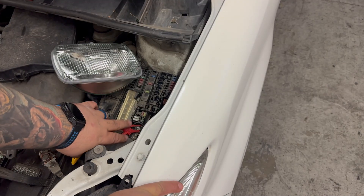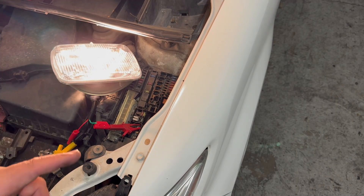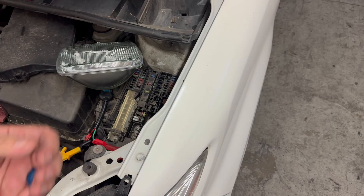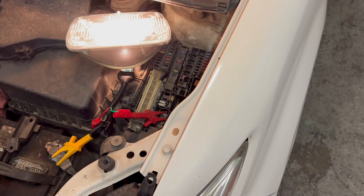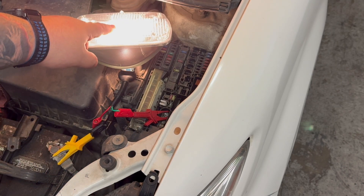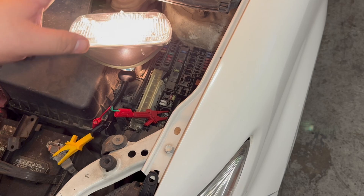On the positive I'm going to the fuse box, now I'll go straight to the battery ground. Notice how the sealed beam bulb is nice and bright — this tells me this circuit can sustain a load of three amps. Make sure you understand what the circuit can carry before you try using a sealed beam bulb or load substitution. If you don't, you'll end up frying that circuit, and you'll be the one responsible for it.